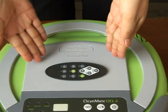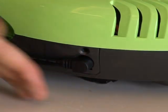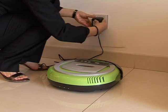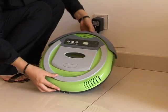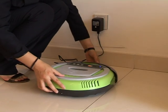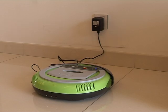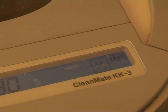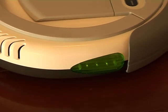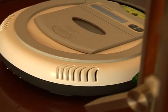The second step: connect the charger with the cleaner and then plug it in. 8 hours is essential to fully activate the rechargeable battery to maintain good battery life and cleaner function. Please note that no matter whether it's manual recharge style or automatic recharge style, the first-time battery activation process is the same.